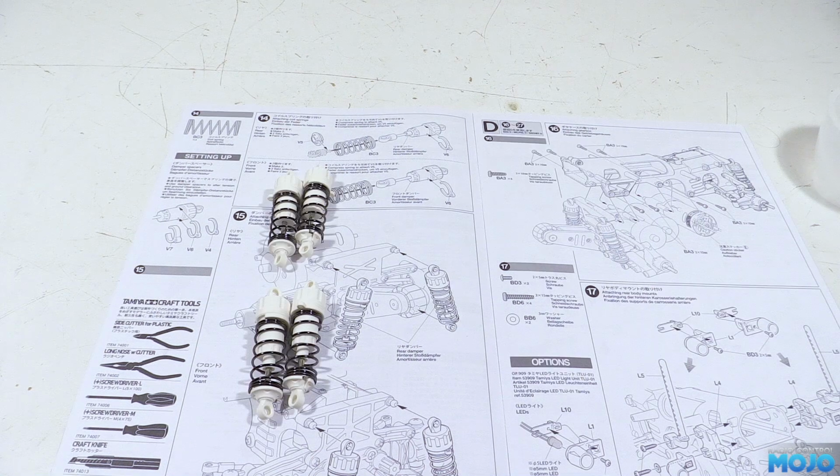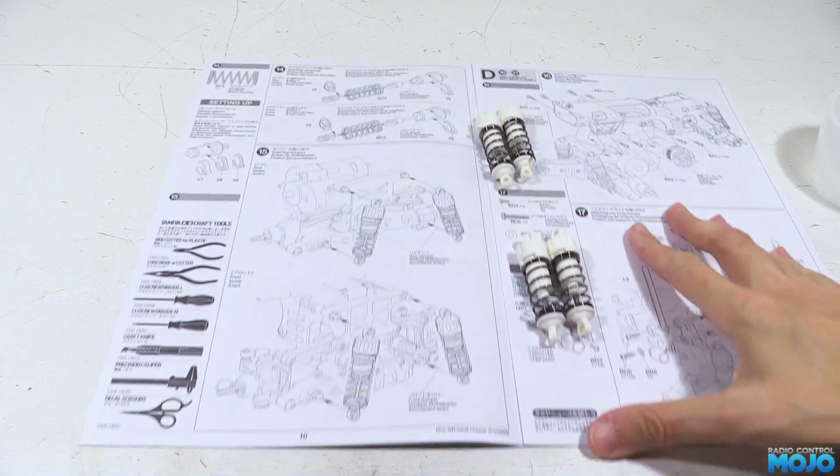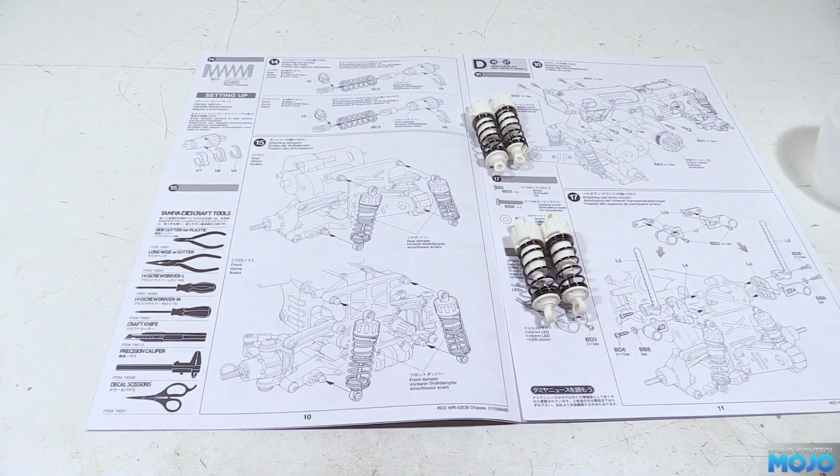It's worth noting the stock springs are really quite soft, great for bombing around a car park or short grass, but if you're going to go off some ramps you might find the buggy bottoms out rather hard. Having a play with the thicker preload spacers might help. Stiffer springs might be better still, but adding a thick spacer might just do the trick.